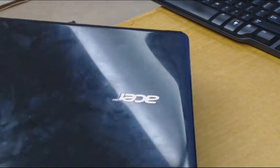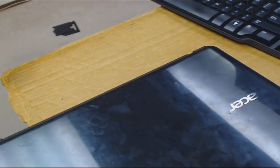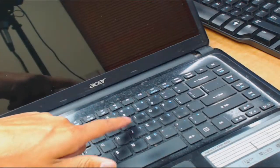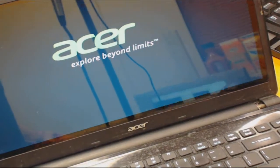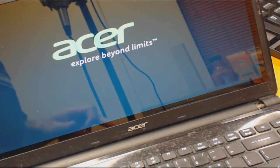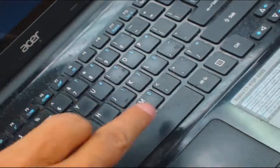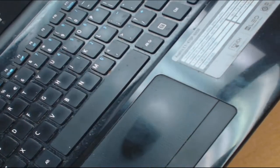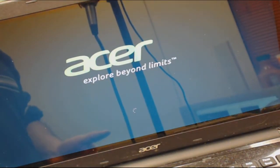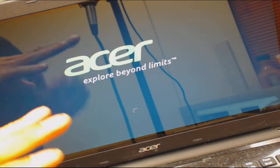It's powering on. The only reason I took the ribbon cable off the touchpad is because it made it easier to get to the keyboard ribbon cable — sometimes you have to do that. But other than that I don't touch it if it's not broke. It's booting up and my next video will be about the hard drive — I won't go through all the unscrewing again but everything else will be pretty close.